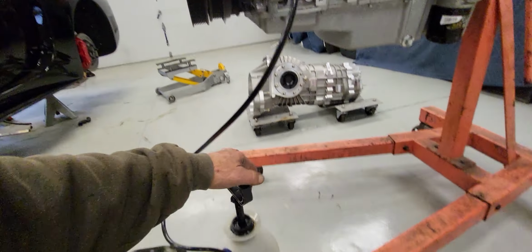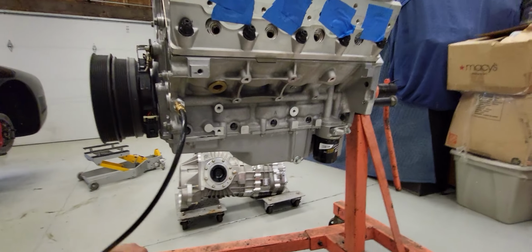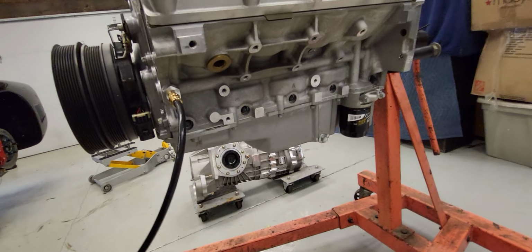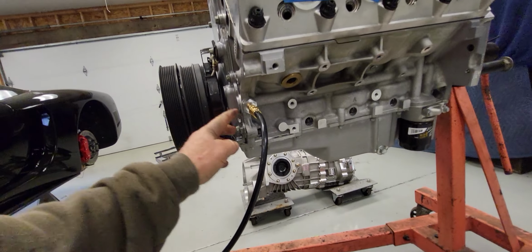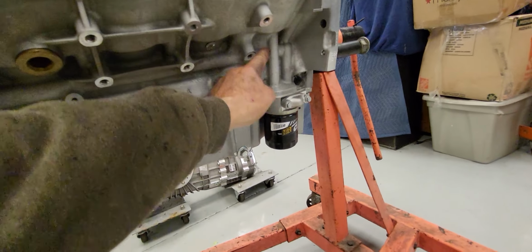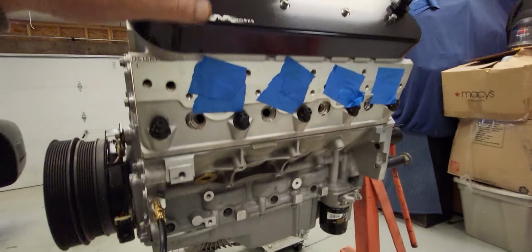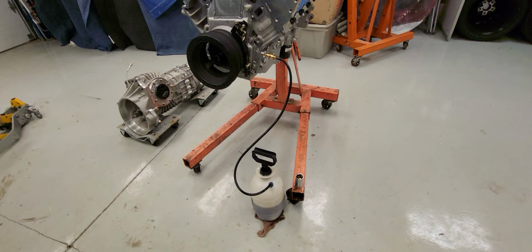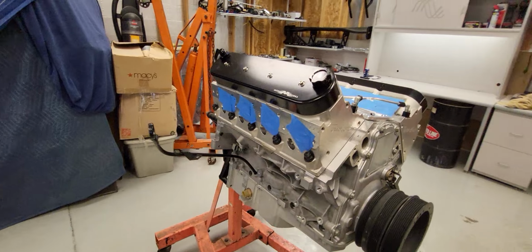I just got done draining the oil out of it. I got it rigged up so I'm blowing oil in it, pressurized. It pushes against the oil pump and then right down through the filter and in through the motor, so it gets oil clear up to the valves, everywhere. Once that gets mostly done, like three quarters of the way, I start to bar the engine over, turn it over a few times, and I do that once a month or so.